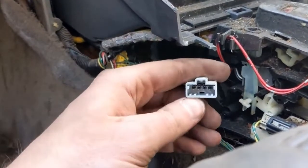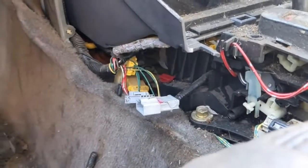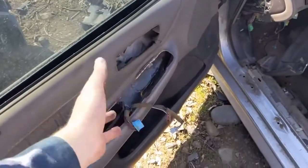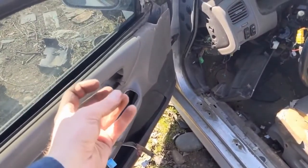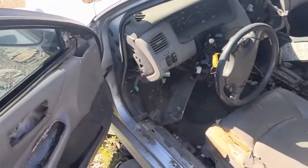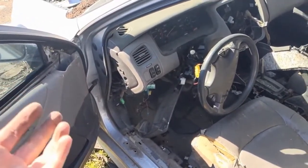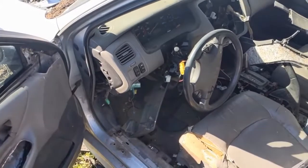You can clip this back. Now you want to go around and find connectors that have different sizes — this is one size, keep that in mind. Under the dash is an excellent spot for that. Inside door panels you've got speaker wires and all that kind of stuff — that's another really good spot to find where a harness is connected to a harness, giving you female and male ends. Find all the different sizes possible for your particular vehicle, and don't worry about specific year because manufacturers often use the same connectors or at least the same size blade terminal over a period of years. A close year is fine.